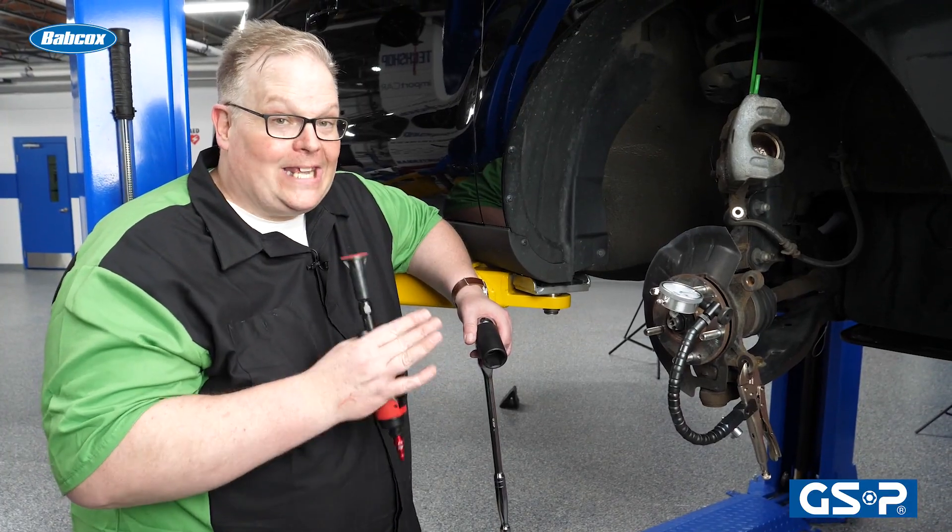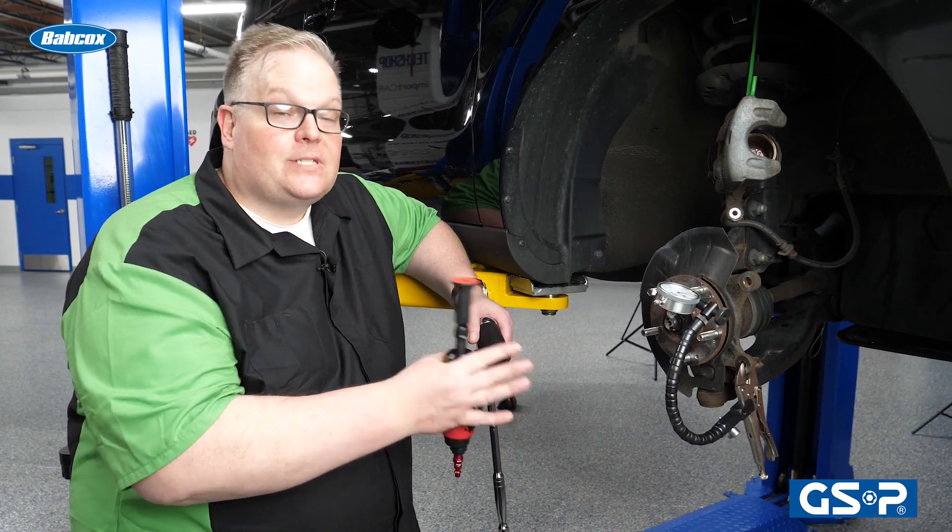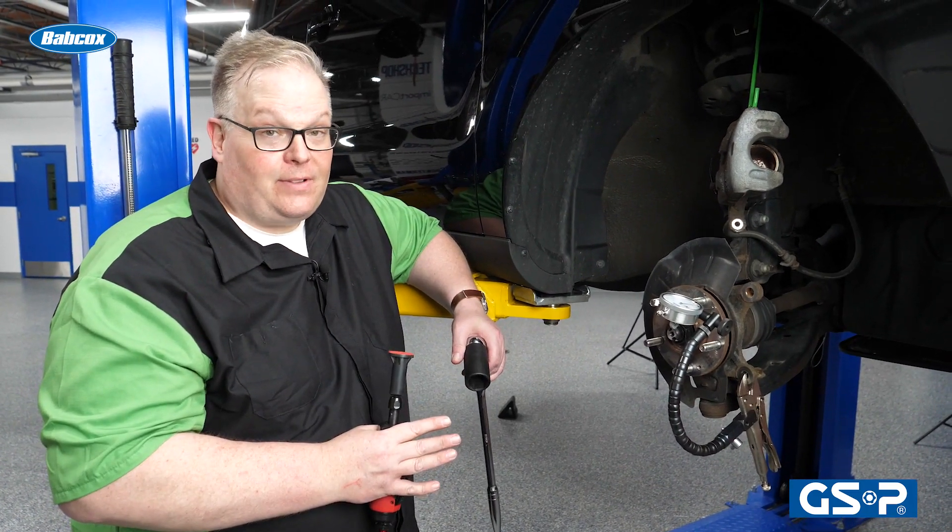You may be wondering how much run out is too much run out. First of all, check the specifications from the manufacturer. Sometimes it may even be zero run out in the flange; in some cases it's 2/10,000th of an inch. Keep it very low, or try indexing the rotor to minimize the amount of run out in the flange.